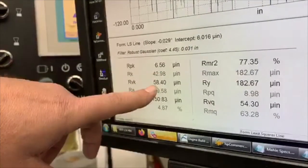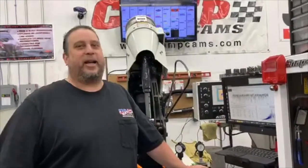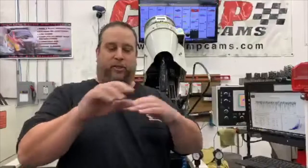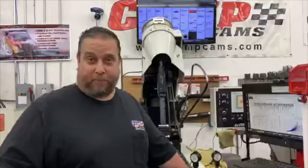But you have to have that big RK and the big RVK. With a chrome ring you have a contaminated oil situation. With diesel there's lubricity to it, but with a chrome ring you really have to wear that bad boy in. The top of the block in this particular case - a Duramax - the first inch and a half is all induction hardened. So it's super hard. If it was smooth, you'd never have a chance to break the ring in. So it needs all that roughness, but that's just a diesel application.